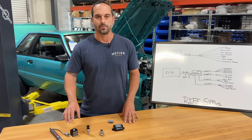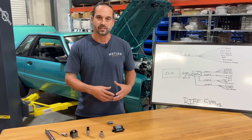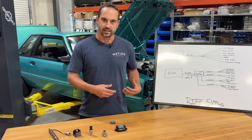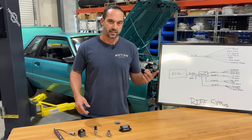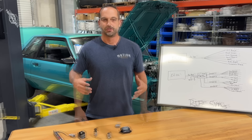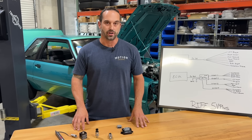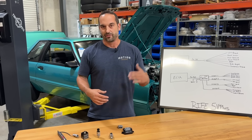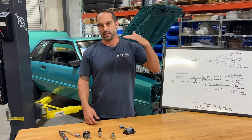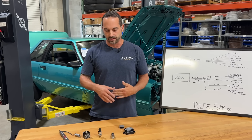There is amperage involved on this circuit — all the sensors draw a very small milliamp value, and depending on the sensor type or the number of sensors, the milliamps can add up. Each ECU manufacturer has a determined milliamp rating for this 5 volt circuit based on their electronics. We've seen as little as 100 milliamps up to about 200 milliamps to provide all the sensors in your car with 5 volts, whether you have one sensor or 25. They're all using that one amplifier. So if we have a 100 milliamp circuit and 80, 90, or even 120 milliamps of sensors drawing it down, our 5 volts — or our 4.93 volts — is now fluctuating, it's not steady. If it reads below what the ECU is commanding, our sensor scaling is off and our sensor data input is off.